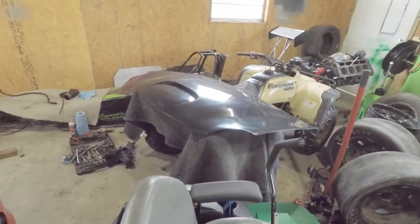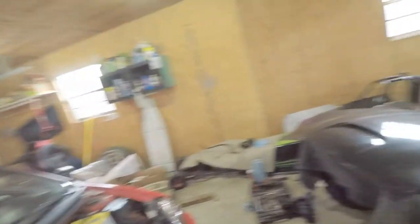I've got the hood off the neon — as you can see it's black. When I bought the car it was completely painted red with a black hood. I went through trying to put some pearl flake in it, but the weather wasn't right — either too cold or raining — so it didn't dry and have the chemical reactions like it was supposed to. It came out textured like sandpaper, so I stripped it down, primered it, repainted it black, and clear coated it again. There are still swirls and hazing because I haven't fully finished buffing it yet.